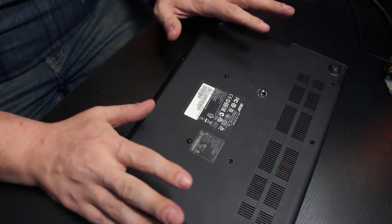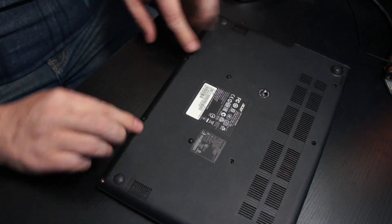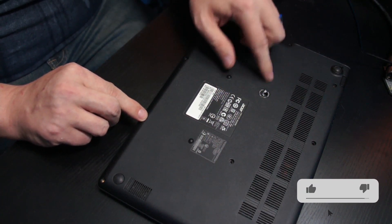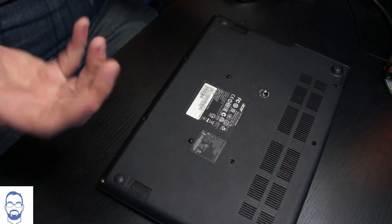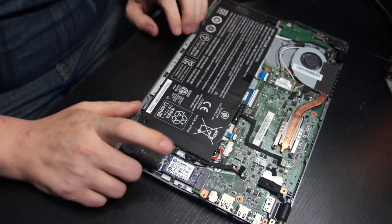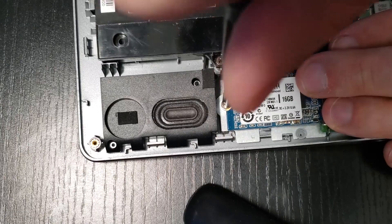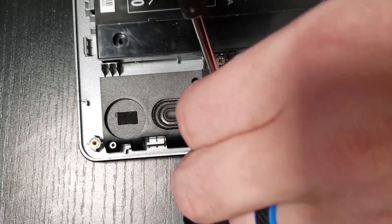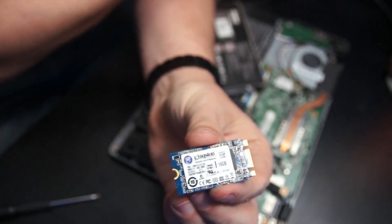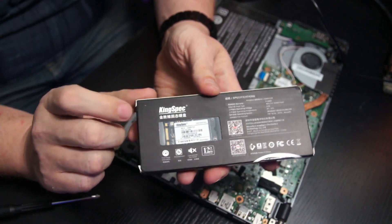So this is the bottom of my Chromebook. You'll probably have to remove all of the screws on the bottom to get in here — also keep in mind there may be one hidden under a sticker for warranty purposes. Once you've got all the screws out, it's just a matter of finding an edge and pulling the cover off. Right here is our M.2 drive. The first thing we need to do is take out the retention screw and remove the drive — and here you can see the 16 gig Kingston drive that came with my Chromebook.